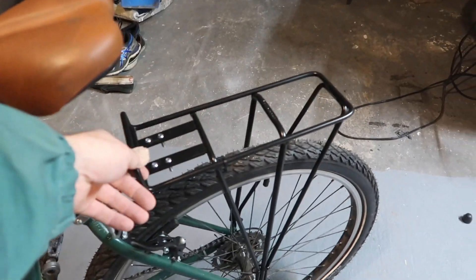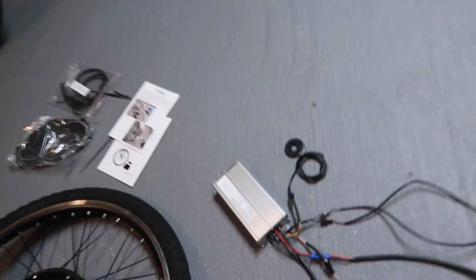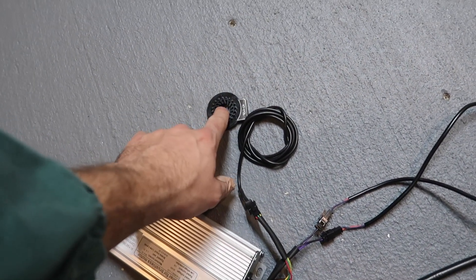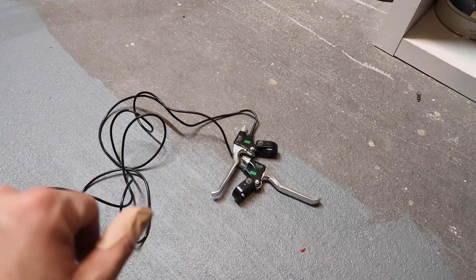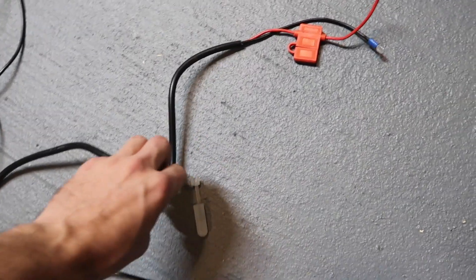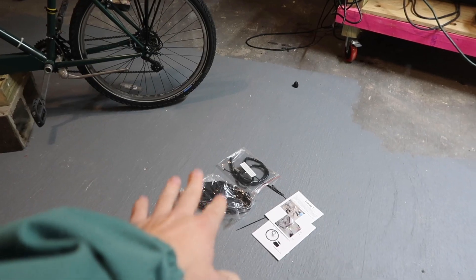I went to the bike shop and installed this bike rack on the back of my cargo bike, and I'm gonna put my battery on here and my controller under here. So let's break this kit down a little bit. This is your controller. This goes in between your cranks to tell your controller that you're pedaling. These are your two brake lines — so when you pull the brakes the engine shuts off. This is the power cable, and it comes with like a little fuse box. I've got a throttle. We've got our display, which is also nice, and then the port that goes out to the wheel. It's a seven-speed wheel and a battery. You get some other directions and little things, but we're not going to use all that.